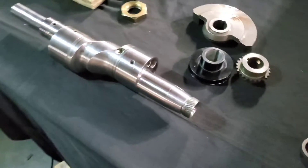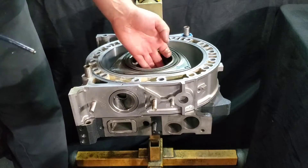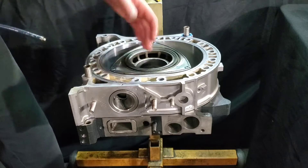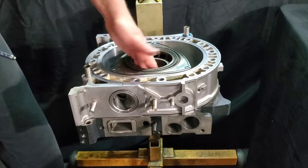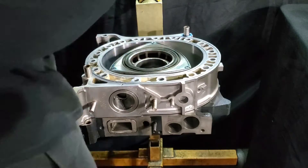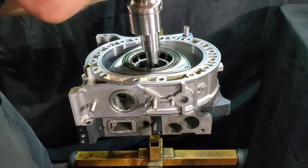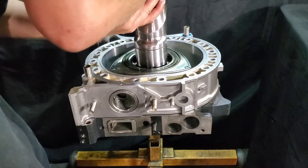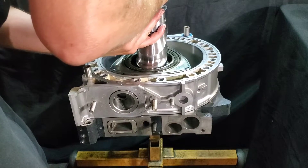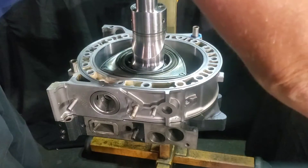We're going to prep our shaft and then bring it over. I always recommend a little bit of assembly lube or oil on all of the bearings as you're assembling. I don't like a super wet motor — I'll back oil the motor after it's assembled and clamped down — but I do want to make sure the eccentric shaft, bearings, and the rotor are lightly oiled to allow for everything to move freely. You don't want any dry bind or coarse bind. Give it a little wiggle, make sure it feels good.